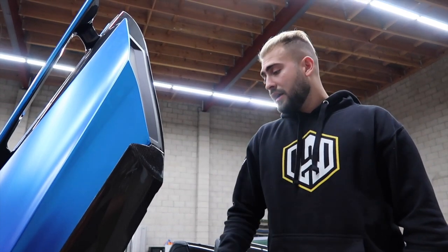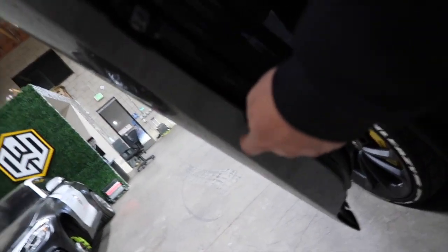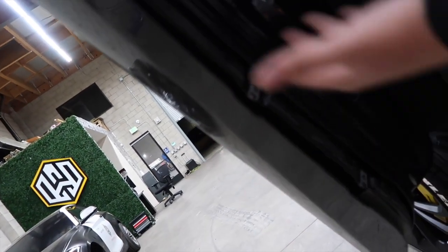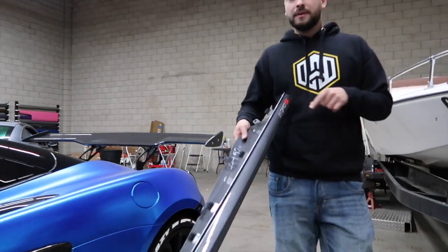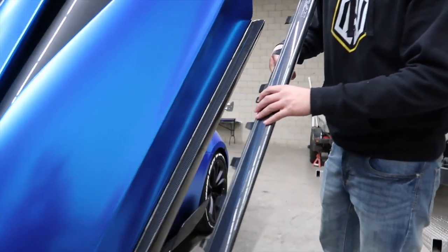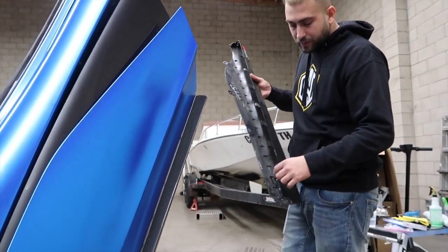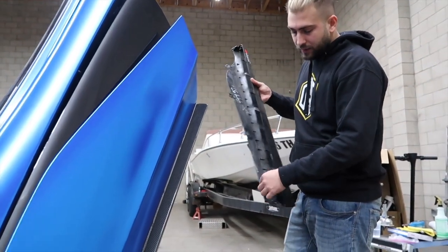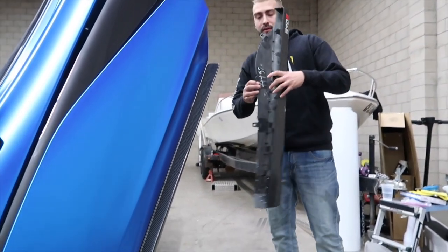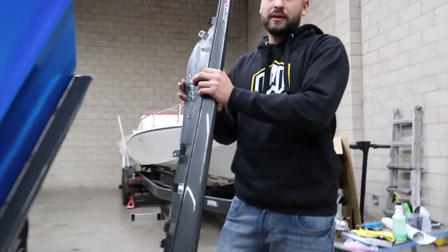It works really well. It didn't hold because there's too much tension just from the fitment. I mean, there's no way for you guys to see this, but I have to apply a lot of pressure to even get this to contact. Right. So that's why the double-sided tape let go. The original piece, same thing. Up here, along here, clips in just like that. Only difference is at the bottom, it has these little plastic brackets that kind of fold. And that's where the screws go, and so it's secured from the clips, and then it closes up, and this is perfect.